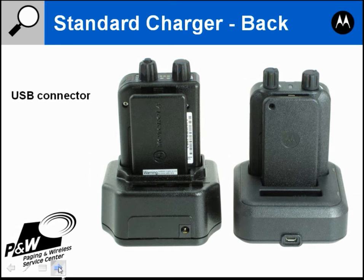There is no mechanism to release the spare battery on the Minitor 6 amplified charger. The Minitor 5 had a little tab you pushed to pop the battery out, and it was common for these to break off. The Minitor 6 charger is otherwise similar — it has a volume knob on the front, a large speaker, a reset button, and lights for the pager and spare battery. Motorola has redesigned the charger to be much more convenient for inserting and removing the pager.